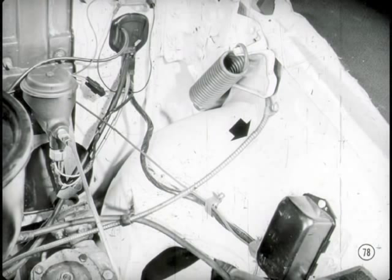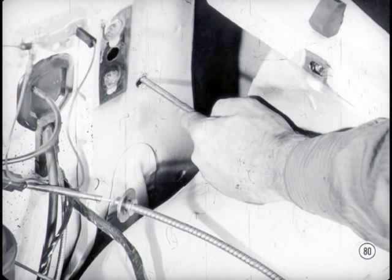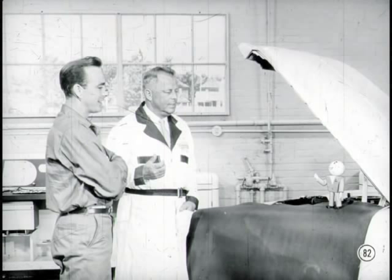If the pedal requires a lot of pressure to apply the brake, it's usually due to kinks or sharp bends in the cable. If the cable is too badly damaged, replace it with a new one. Another possibility is misalignment of the cable hole in the dash panel, which doesn't allow proper cable alignment with the lever. The fix in this case is to disconnect the cable at the upper end and remove it from the hole. Then elongate the hole by filing in the necessary direction until the alignment is satisfactory. What about that crunchy feel? That might be due to misalignment of the cable with the lever — you would follow the same steps to correct it. Or it might be due to lack of lubrication in the cable, so lubricate the upper end with SAE 30 engine oil and let it work down.